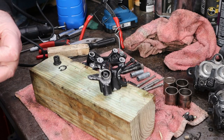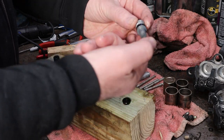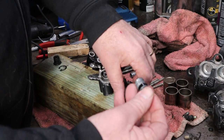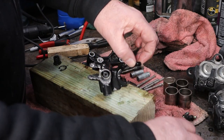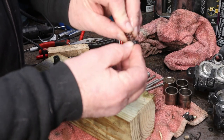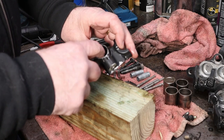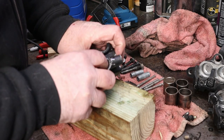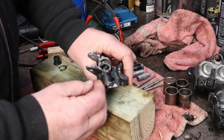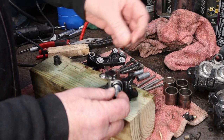First thing I want to do is put just a little bit of brake fluid around this piston seal, and then we want to put some around this next one - this is the one that keeps them from leaking out the back side. There will be brake fluid in here but this seal stops it from coming out the back. So we'll set this inside our spring and slide that in there - kind of like so. You need to make sure that goes down in there and doesn't get its lip caught on the edge of the hole, so I'm just going to turn it and work it in and feel it pop in there. Now we're going to take our piston and do the same thing, but we need to get our snap ring ready because it's not going to stay in without that.